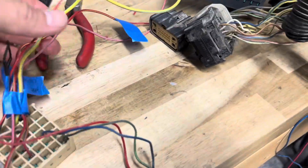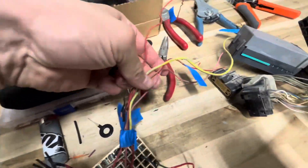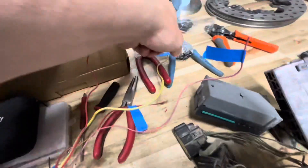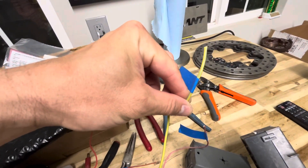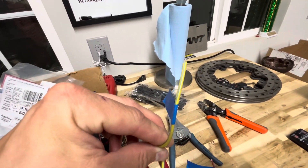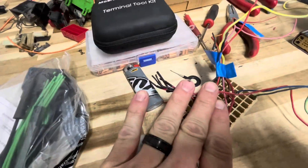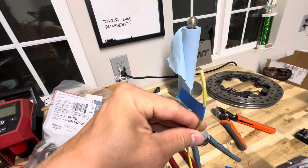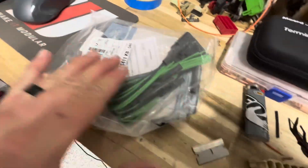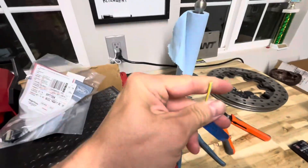The audio in the next couple of clips was corrupted with wind noise. What we're looking at here is that C1035B connector at the fuse block. The yellow wire is the starter relay output — it gives the starter solenoid its 12 volts after its relay. That's the first connection on the connector we're about to make, since it's pin one.